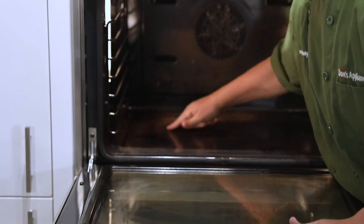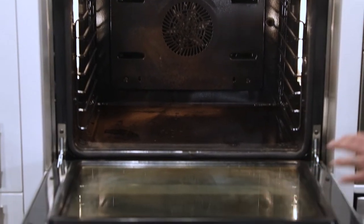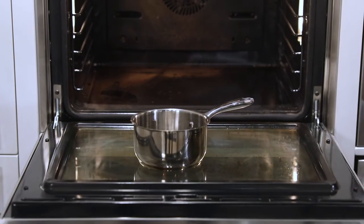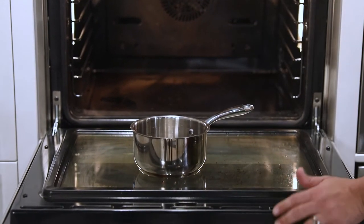When we look in here, we just have a little bit of buildup in the back and a little bit on the sides — this is normal. What I like to do is use a little pot with equal parts vinegar and water and two tablespoons of baking soda. That works really well. I also use magic eraser sheets — just put a little bit of the magic eraser sheet in with a little water and get going. Usually this combo works pretty well.